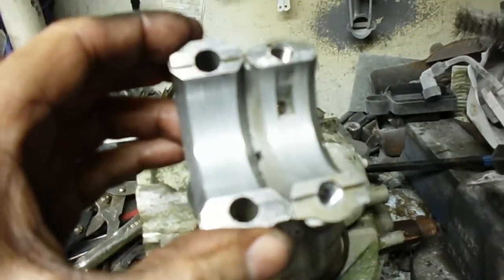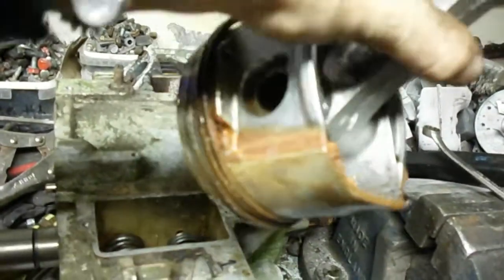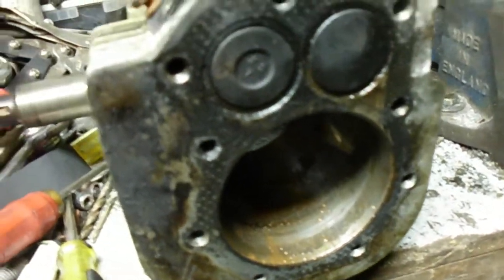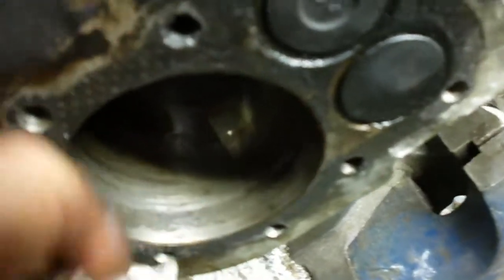I got the first piston out. The bearings in the rod look good. Looking at it though, you can see it's been sitting in some water - there's about half an inch of water line right up the piston. The rings are intact, so that's good. There's water in the bore, which is one of the main reasons I decided to tear this down. It did actually pit the bore a bit in the area where the water was sitting - there are tiny pits.